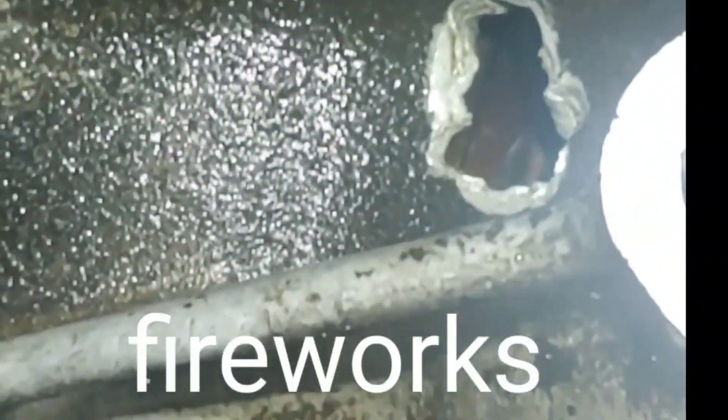Now that is dangerous — I got comments saying 'hey, I'm going to blow my motor up doing this.' No, that's on the turbo cars that are loading up their cars with anti-lag — tons of fuel, taking away timing, they're actually loading up the motor. I know for a fact, because I blew up a motor by doing this. I was doing rolling anti-lag, threw a rod on the block, and that was the end of that. But I think this is completely safe — you're not messing with any of that, it's just straight up ignition cut and messing with the delay of the ignition.